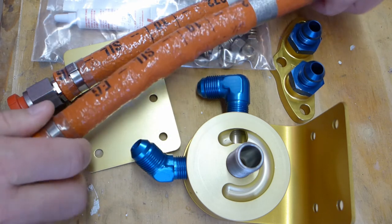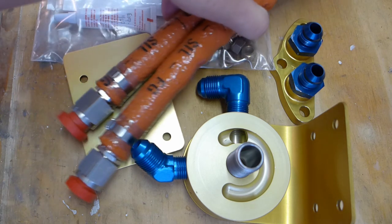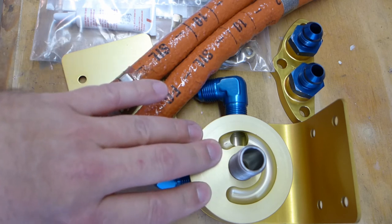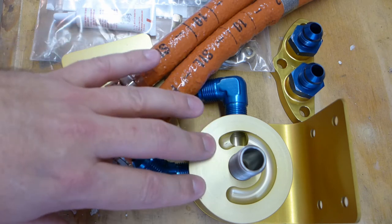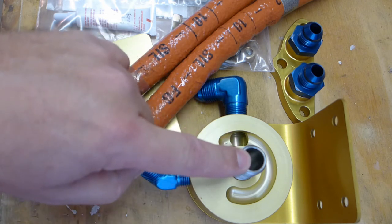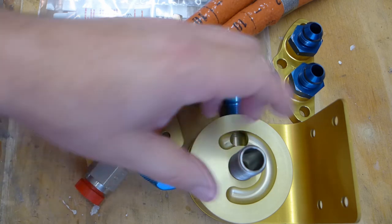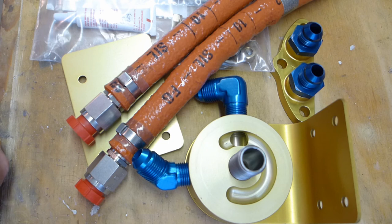You've got low, low pressure oil going through here. Oil is important, but good grief. What is this buying me? My oil filter change interval. So the engine comes with a screen, an oil filter screen — you gotta change the oil every 25 hours. With a filter, you double your oil change interval, and it's much easier access. I'll just pop the cowling open — this will be right there, very easy to access, so it'll make it more convenient. So it's a matter of convenience.